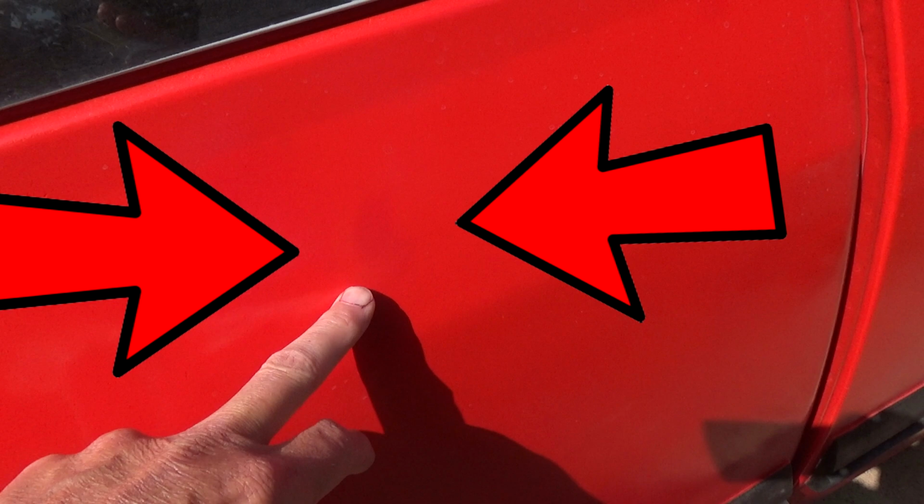But I knew this was an issue when you paint outside without a booth. I'm going to get a portable booth. I plan on doing this again, so I learned my lesson here. My second mistake was to leave it out in the sun, because I thought maybe if I left it out in the sun, it would dry the paint better. Well, it caked the bugs right into the paint.